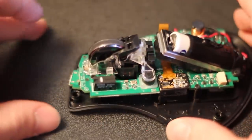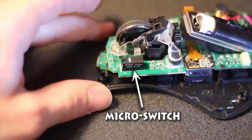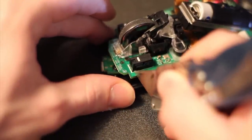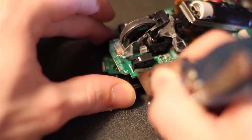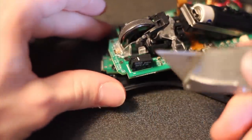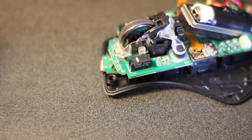You'll notice that there are two micro-switches on the front — these are what control the clicks. To take that part off, you simply stick a fine knife in the edge, and you can see you can bend it out and it'll just pop off the top. But before you do, just a quick little trick.